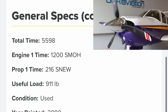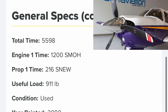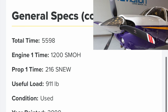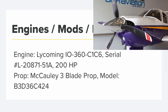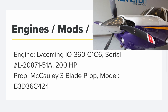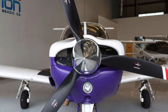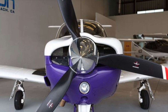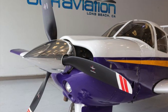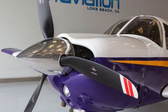A quick review of the Aero's ad shows an engine with 1,200 hours since its last major overhaul. There aren't many more details, but since the total airframe time is over 5,500 hours, I have to imagine the overhaul was relatively recent. It appears this engine does have its stock exhaust system, and I have to assume there are not any other significant upgrades, as they're not listed. The prop, however, was replaced much more recently, as it only has 216 hours since new. While it is a Macaulay unit, it's a three-blade version, which seems to be more common on the Aero than the two-bladed option. Perhaps some Aero enthusiasts can inform us in the comments below. The three-blade prop might slow your cruise down a touch, but should allow for better climb performance.